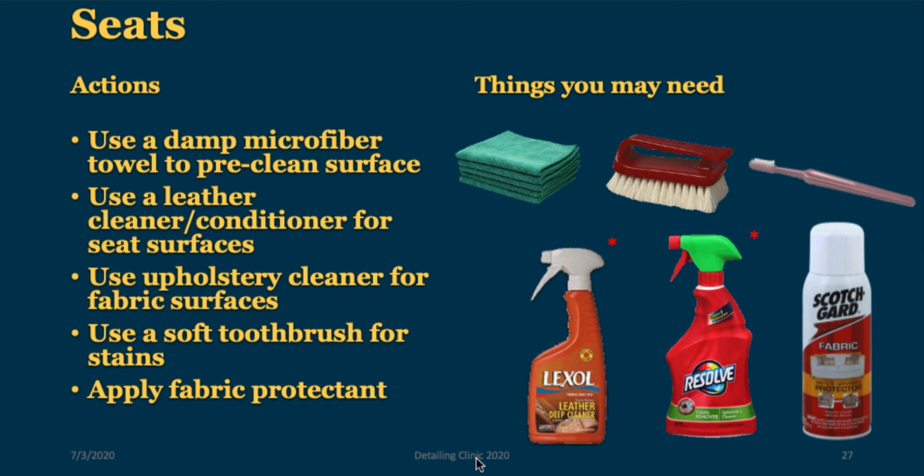One other thing, I have a light interior, so I use a cover on the driver's side. You can order them. If you order a seat cover or any type of seat protectant, I will give you a bit of advice that cost me a hell of a lot of money. Do not get anything that's got a black urethane finish on the back side. Because what happens is that black urethane will leach out into your white seat cover. My last convertible had a light gray interior. I took that seat cover out, I was getting ready to clean the car and I almost died. The whole interior was a nice shade of yellow from that black leaching out of that foam on the back of that seat cover.